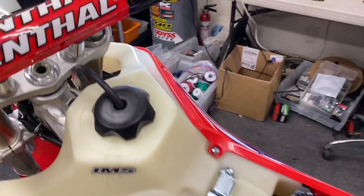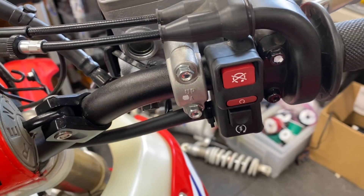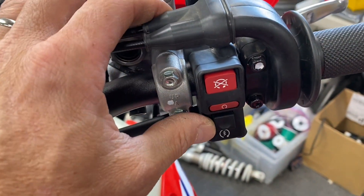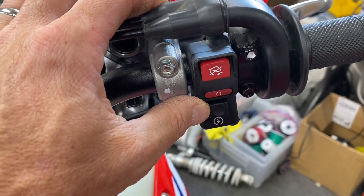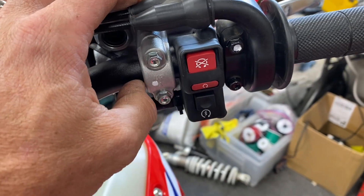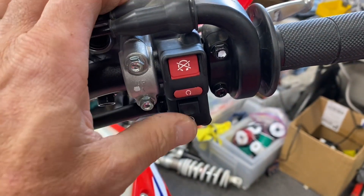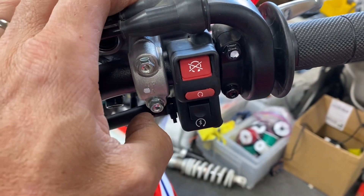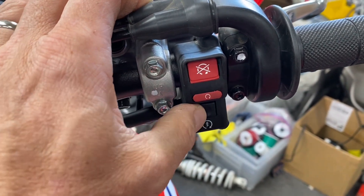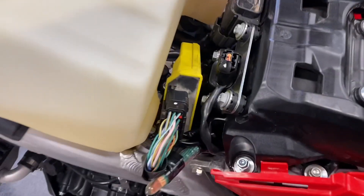The thing about the 450 is it's got this toggle on and off switch, and the reason why we need to do this procedure is because with the Vortex, to set the endpoint limits, we need to crank the engine and then hold the kill switch at the same time. It's not possible because if we go to kill mode and we hit crank, we don't get a true activation of the bike — we don't start the bike, we're not attempting to start the bike. So we need to do that through a pin here on the back of the ECU.